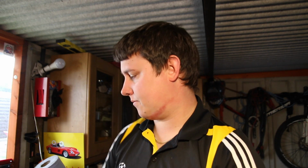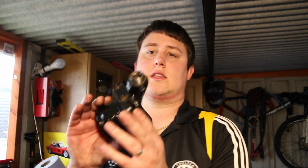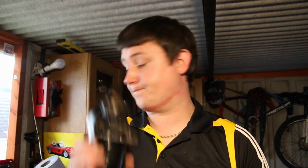Put in a very thin shim, there's too much play, remove the shim, remove the next size down and put a thinner one in, put a thin shim in, it's lock solid. You put another thin shim in, and it's super loose. So yeah, it was an absolute nightmare. But it's done, one side's complete. I've now got to move on and do the other side, top and bottom ball joints, and then I'm going to look at doing the wheel bearings.